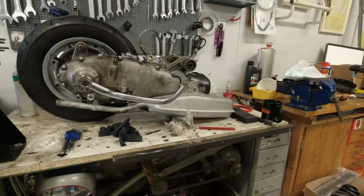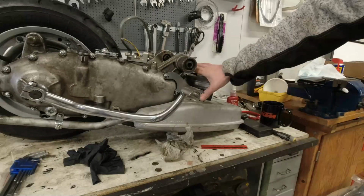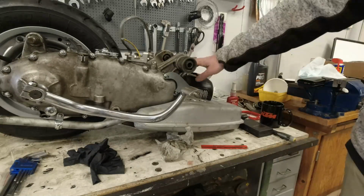I have fit an RT225 on this. We have kept his old Mazzucchelli crankshaft. That was in really good nick, so that was good. We have a standard clutch in this, and I've fit BGM plates and new friction plates, so that was good. What else have we done? Yeah, loads of little upgrades, a Casa Performance pull down chain tensioner, and just really tidied it up. In this particular case, I have fit a Casa Lambretta inlet manifold because the BGM was empty,